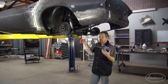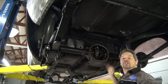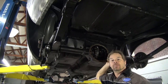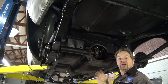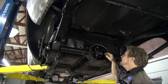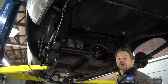This is Zed Sled. It's going to have modern LS power, and the potential weak link is the factory rear axle. GM produced nearly 300,000 of these cars in 1978, and this is the rear axle that came in 99% of them — a GM 10-bolt rear axle with 8½-inch ring gear. From the factory, this Z28 came with a 3.73 ratio and limited slip, but this one's been changed to a 2.55 and an open differential, which is terrible for traction and is going to be a dog on launch.